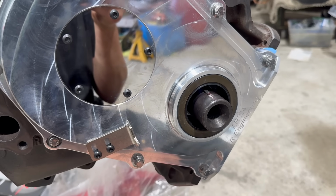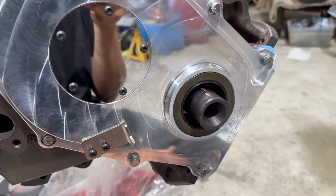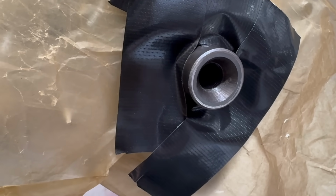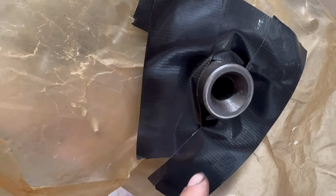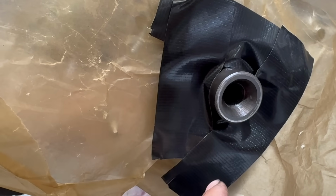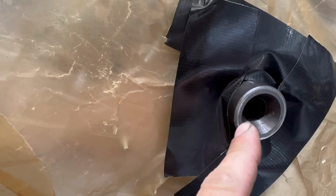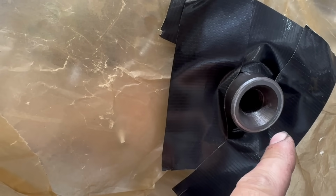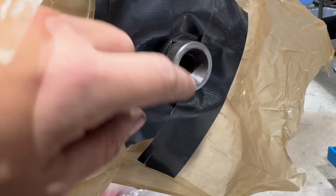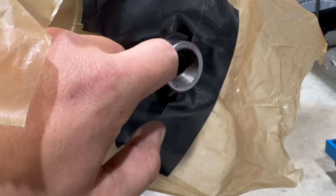If those do exist, well, I don't have one under this roof right now. The other solution I came up with, which I can do right now, is file the snout of the crank. So I started filing after putting a little bib around this thing to hopefully prevent material intrusion. And look at this. The file is only hitting that ridge on the outside of the crank snout because it's not flat. I really don't know how hard I need to go here, but I'm just going to try and get all of those shadows gone.